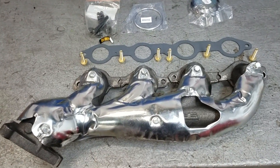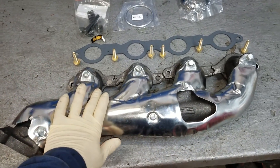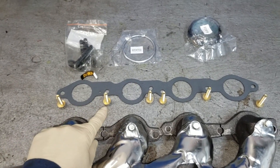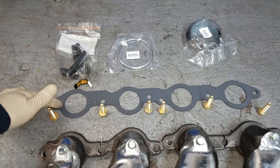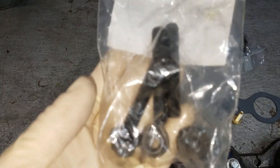Flowery Mechanic here. Today we're going to be replacing exhaust manifolds and manifold gaskets on the Chevy 5.3 liter — this also applies to 6.0 liters. We're going to be putting in new gaskets, new manifolds, new hardware, and new studs for the front pipe.